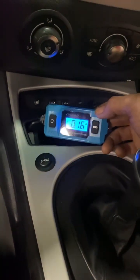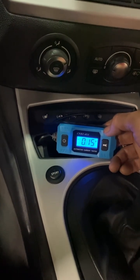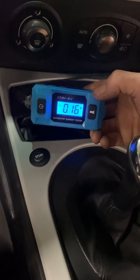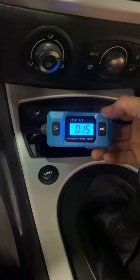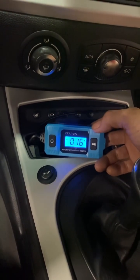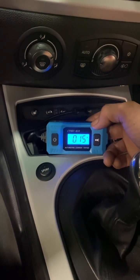As you saw from the previous image, it dropped to about 0.12 of an amp when it started going tits up. This is a brilliant diagnostic tool to check for current draw from individual circuits. It's actually the terminal 30 fuse — it says terminal 15, but it seems like it's terminal 30. So this is a great tool for checking for intermittent current dropouts.